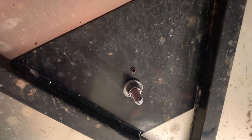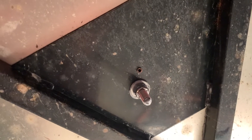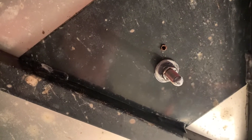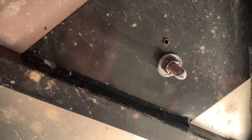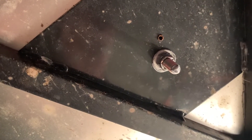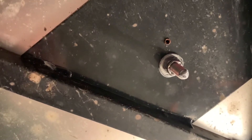Over here — I mentioned previously the seats. The way they bolt seats in these things, they're just supposed to be lagged through into the frame in four spots with just a lag bolt. On both sides I did put an actual bolt with nut and washers in at least one location I could get to. The others go into the round tube frame rail so there's no access, and the third one goes into the large square tube which I can't get a through bolt through. So this way I at least have something to give me a little more faith than just the lag bolts.